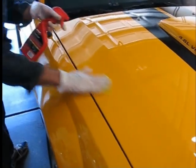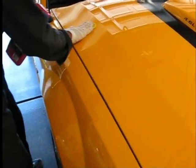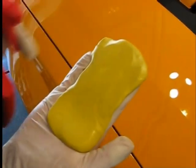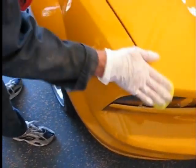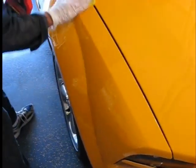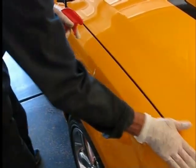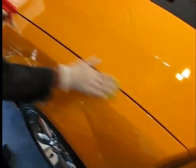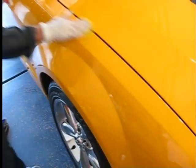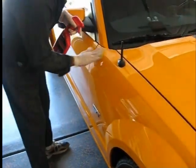Unfortunately they're cheap vinyl stripes — next year they'll be painted. It's a pretty straightforward process — when you don't feel any more grit, you'll know it's cleaned out. There isn't much to lift out of Pete's paint but there's a little. Don't try to rush — I don't like doing clay bar because it takes forever if you do it right, but the results are worth it. You can feel the grit as the clay cuts contamination out of the paint, which demonstrates it's working.